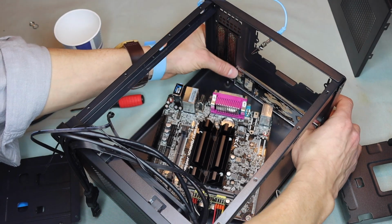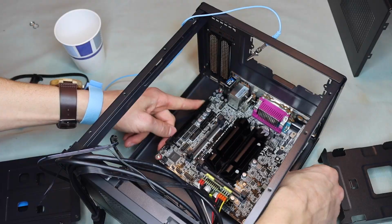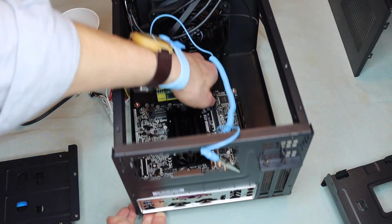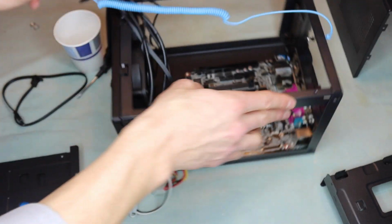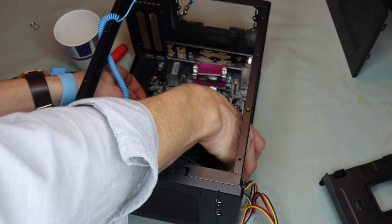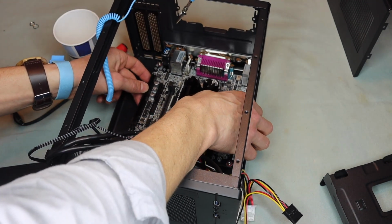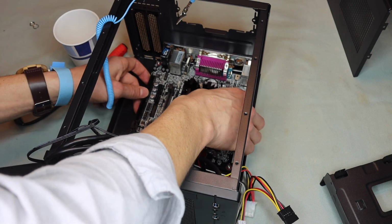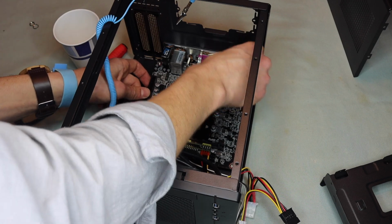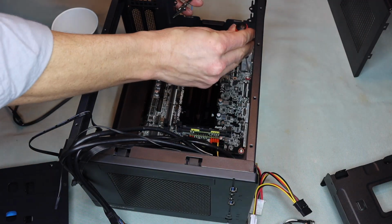Make sure to pre-drill the hole for the external jack for the power supply before you clip it into place, and it just sort of slides into place. It will align with the ports on the back of your motherboard, which will also help you align the motherboard on the risers. So it's really easy to just screw it down once you slide this into place. The external jack will go through a little hole, which I drilled next to the very far left-hand side of the back faceplate. Here you can see me pushing it into place. Now I'm going to screw it in, and we're going to go from there.